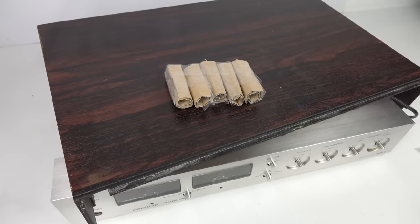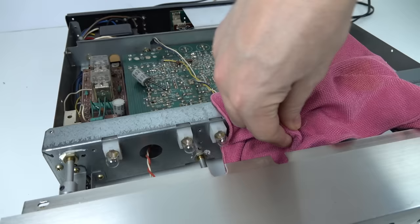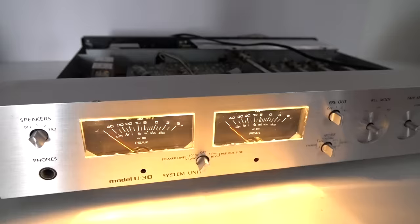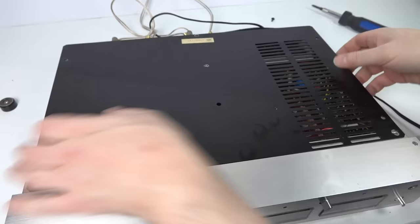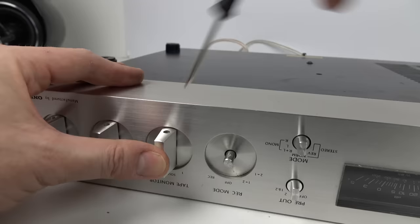Of course this bulb has a little bit of a blue film on it. I wasn't able to find any like that, but I was able to find some replacement bulbs on eBay. So I've got five of those just in case one of them doesn't work, and I'll screw them into the front here. I looked around to see if you could get blue film and you can, although I'd have to import it from America, so I think for the moment I'll do without. Let's flick the switch and see what it looks like - yeah, that looks nice and bright. So let's put the front on it and see if it illuminates fine inside. Brilliant, everything seems to be working fine. Before we put it all back together, let's just do a bit of cleaning as this has got a few nasty stains here and there. I'll use some contact cleaner on those switches to make sure they don't crackle when you move between the different sources.